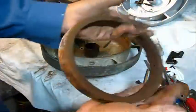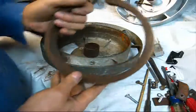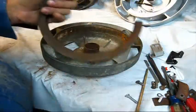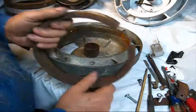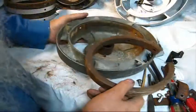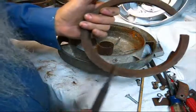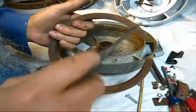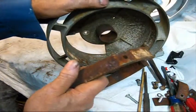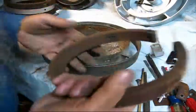That's what the ring looks like once you get it out — you can see how bad it's rusted. You can clean them up by putting them in electrolysis. They do have magnetism, and the first thing you're going to say is — well, you didn't mark which is north and south. Actually, it doesn't make any difference. If you take 20 flywheels from 20 engines and check the polarity, they will not all be the same. I never pay attention to that personally and I never have any problem.